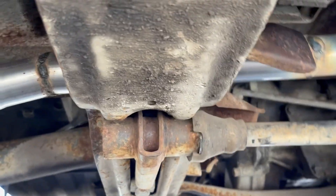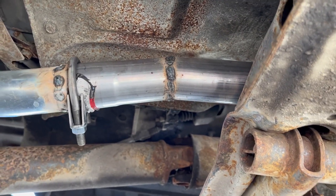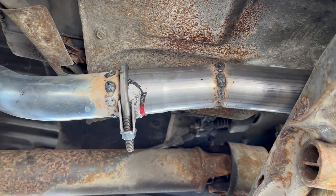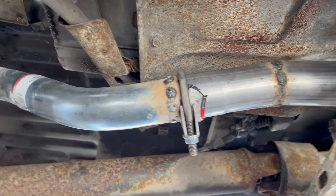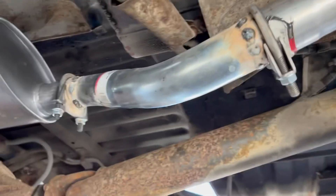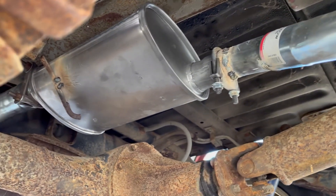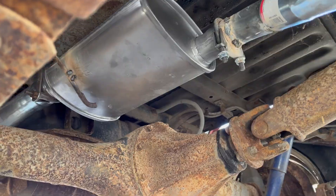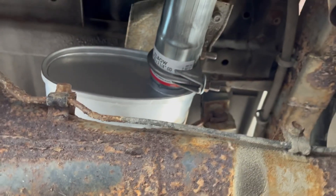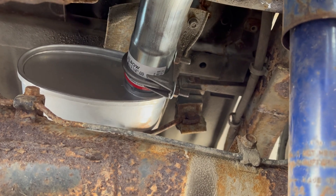This was the hardest part — getting it through here with another pie cut and keeping it off of this crossmember. I can take this clamp off; that's as welded as that's going to get now. It's about 90%. It's got a 45, it goes up to our muffler. The muffler is in basically the stock location, a little bit smaller than the original. It's coming back over the axle and it's clamped here, not welded, just because I had no space to get to it.